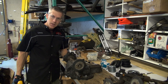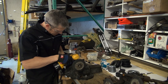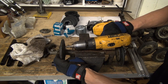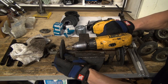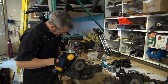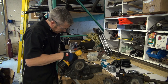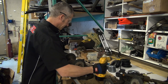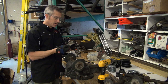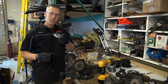You're going to want to reuse these old grease nipples unless you see a problem with them. Once I've got those grease nipples off, I just come in through the back side of the wheel here. They're all riveted in — you just drill them out. Pretty much any size drill bit will do it. Just pull the cap off. Now you can reuse these old caps in some circumstances, but if you want that nice freshly rebuilt look, you're going to want to use these nice new fresh ones from Kimpex.